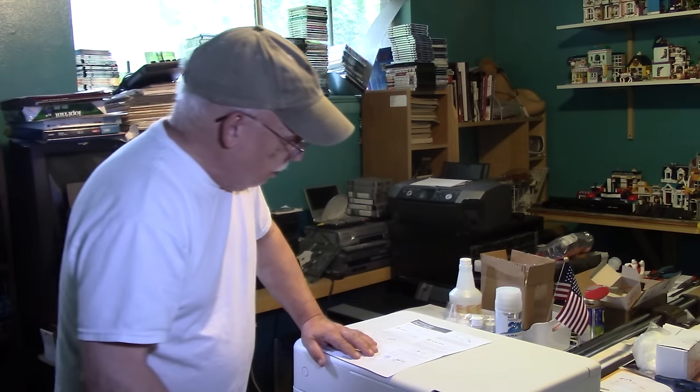That's with anything. Any kind of printer, especially those that have stationary cartridges, okay? Like the Epson higher end models, they have cartridges that do not move. They have to basically fill those empty ink lines and the internal head dampers with ink, and also expel some of that ink to make sure that the printhead has been properly charged. You will probably use at least a third of your ink that way, in most cases.